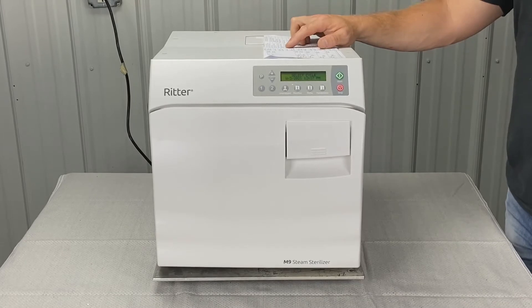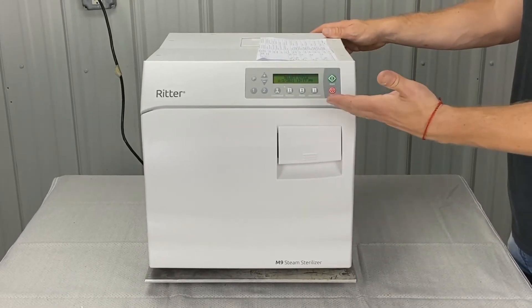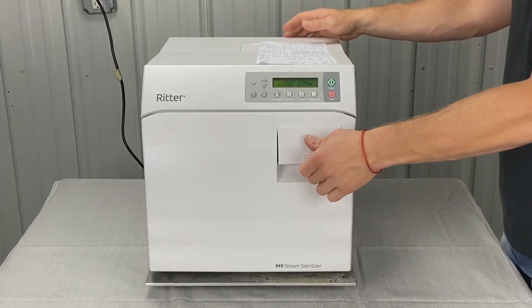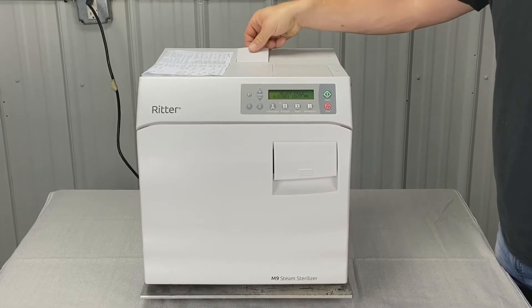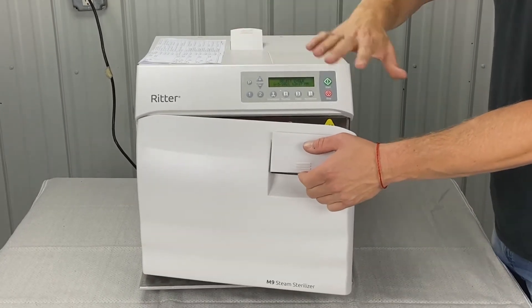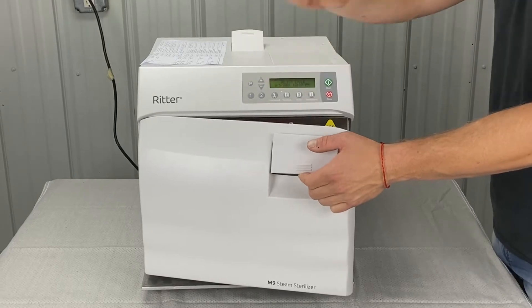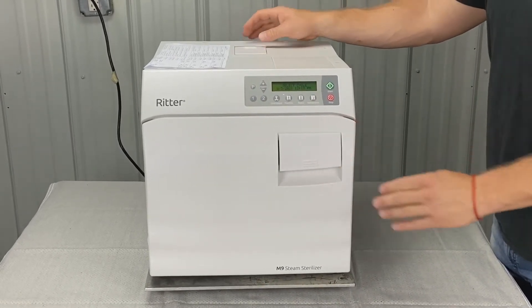So if this happened immediately, your door may be shut. Your power is off obviously, and you might be able to get the door open. You might want to try and pull the pressure relief valve — pull up on it, let the pressure off, and then open the door. Don't get your face too close; there could be steam billowing out. You might want to wait 10-15 minutes and let it cool off.